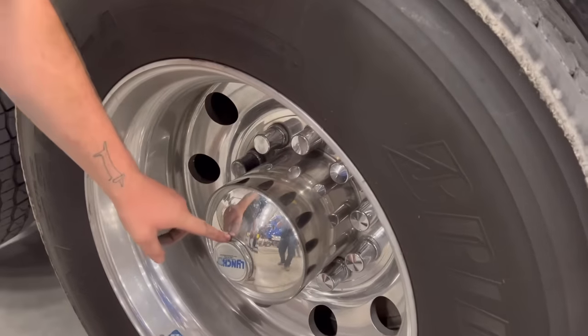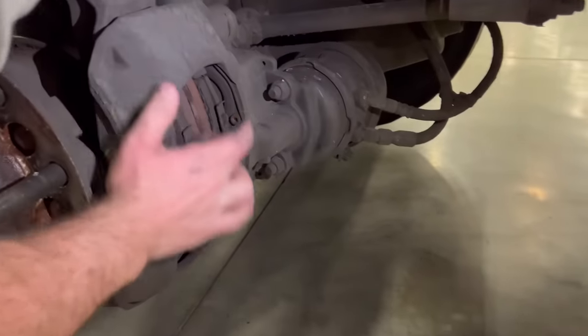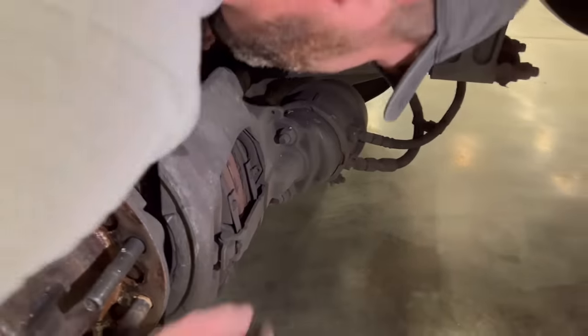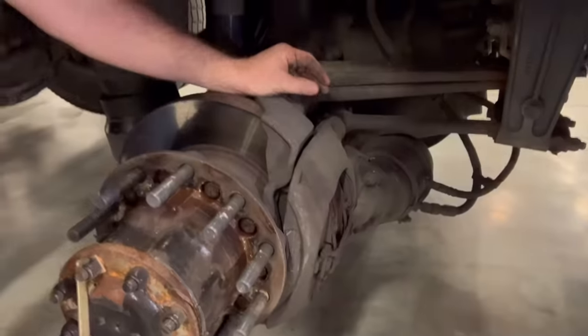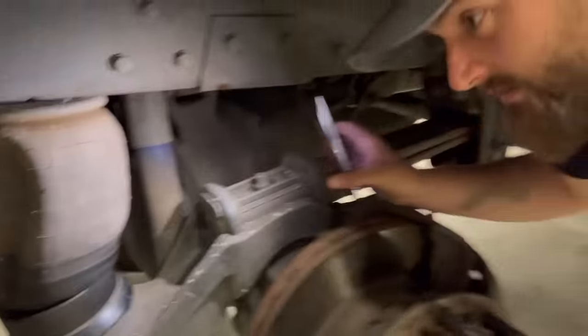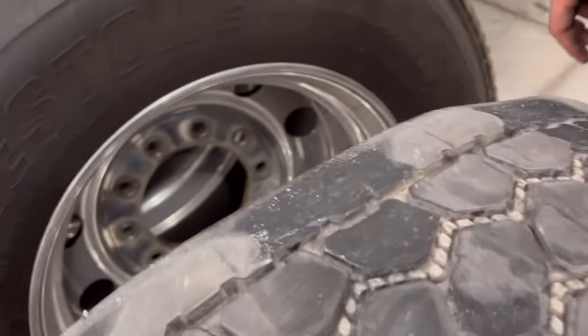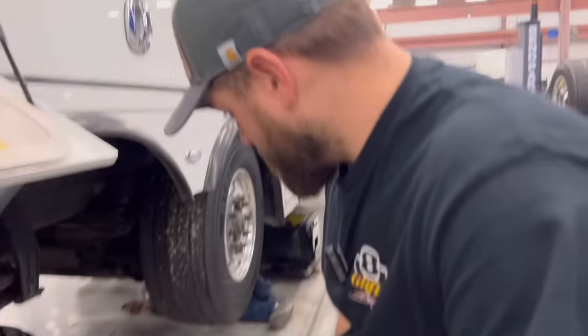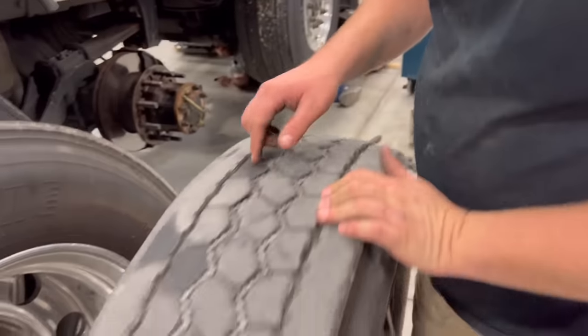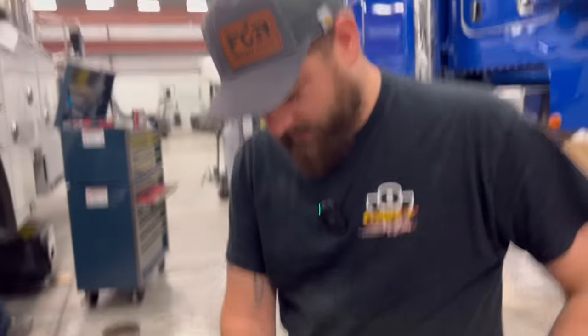The rear wheels are off. The pads are starting to wear — the inside pads are looking a little thin but not as bad as I thought honestly. I think it's just because of how heavy this thing is. Airbags don't look bad either. The big thing I want to point out is the tire wear — look at this tire, it is junk. That is a really weird wear pattern, probably from the turning and the weight. Tires are going on the list.